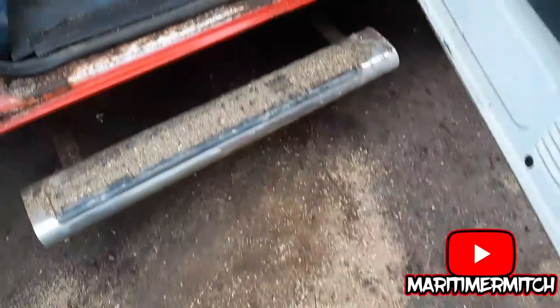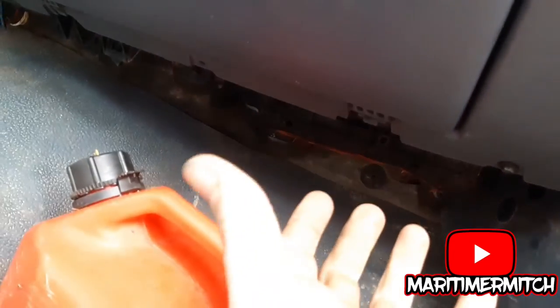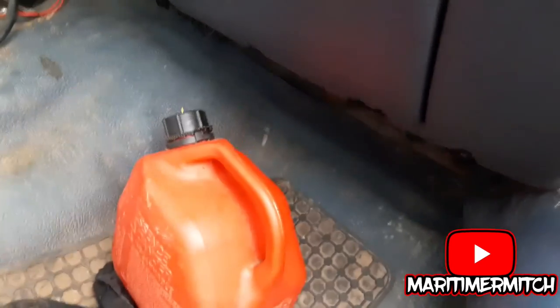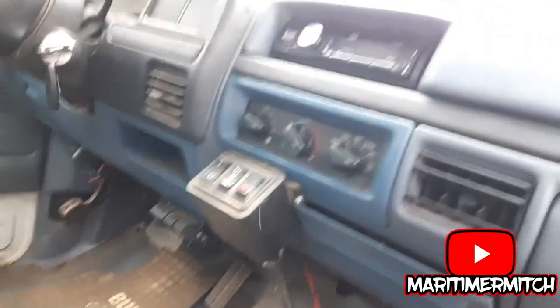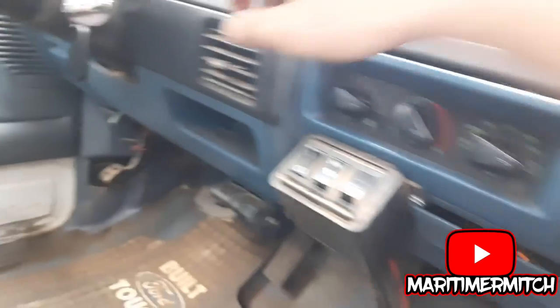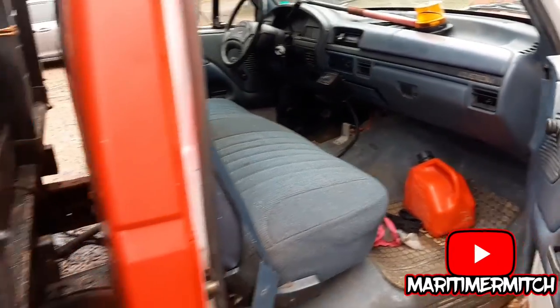So I got all that out of the heater box and all around the running board. Basically, I took out the bolts from the bottom of the heater box, pried it open, and started shoving the vacuum up in the vent line. I found the clog, and now the heater works great. There's a bit of debris blowing out of the dash, but at least it's working now. So he'll have heat to use his salt truck.